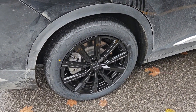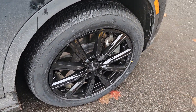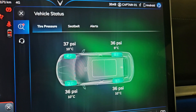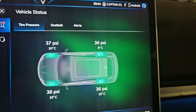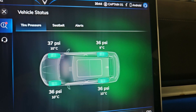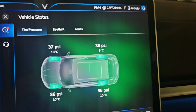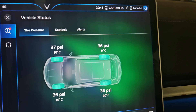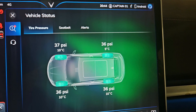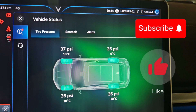Definitely need a car wash, but got the alloy rims on with the winter tires, and the sensors all look great. I'll put a link to these rims in the video description below — definitely going to be great rims for the winter. And I got them done here at Tire Mart. A check in here in the vehicle — the TPMS sensors are reading just fine off the four winter tires. No reprogramming needed on the Vinfast. And if you are just swapping your winter tires and keeping the same rims and the same sensors, you also don't need to worry about reprogramming. The vehicle will just pick up and read the pressure settings as you drive. All set once again for the winter — and spring can't come soon enough! I hope this video helped. If so, please like and subscribe and share. Bye for now.